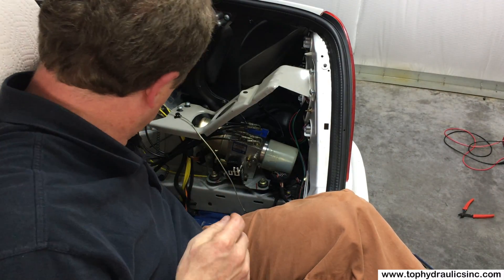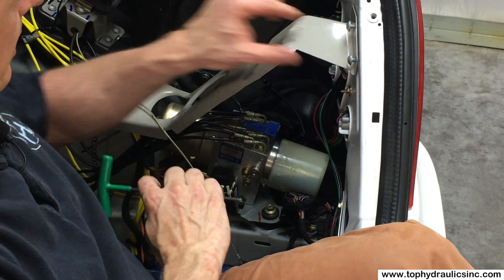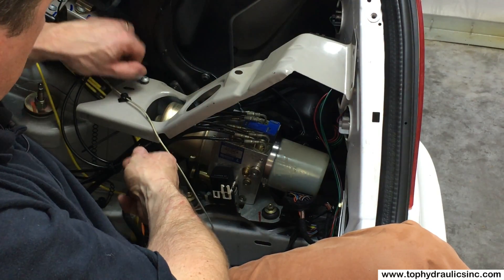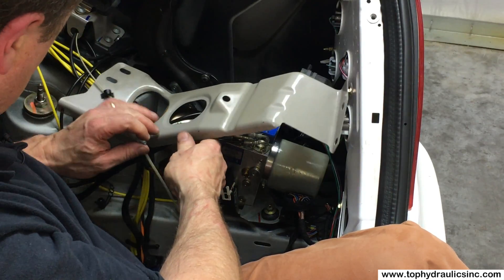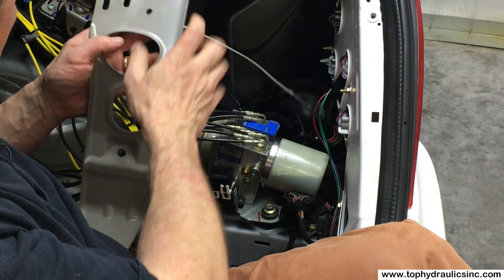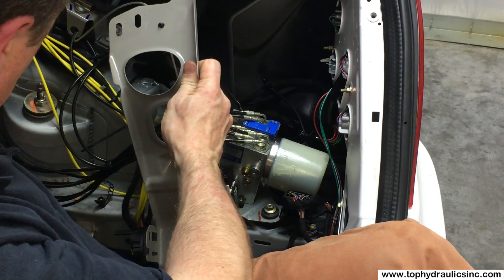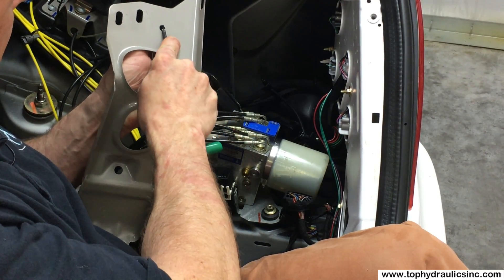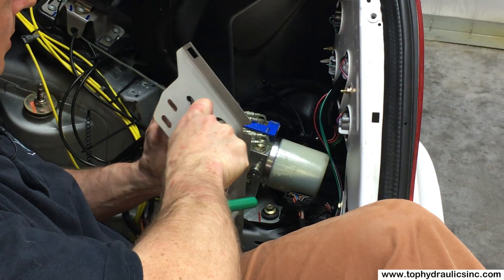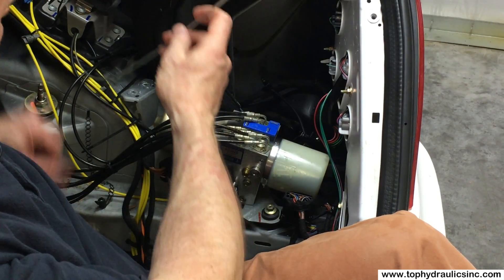We don't need many tools — just a T30 wrench to get the four bolts off the bracket. We've already loosened the four bolts for the bracket above the pump, so I just unscrew them now. For the holder of the release cable, you pinch on the bottom and work it out — though you may need a tool like pliers, since fingernails alone may not work. So that bracket is now out of the way.